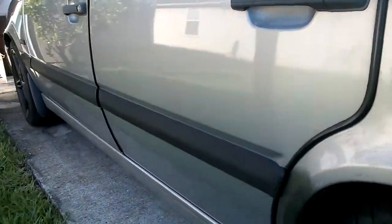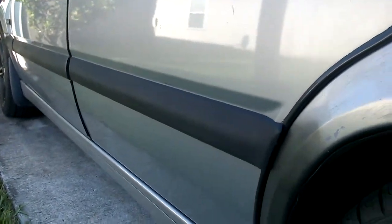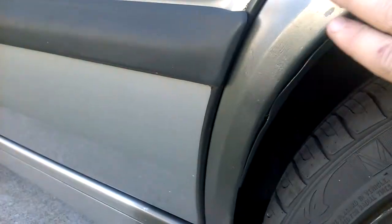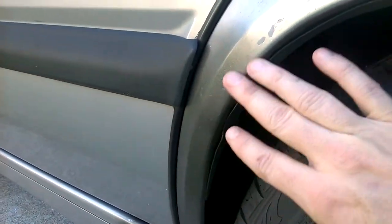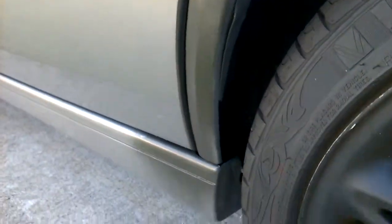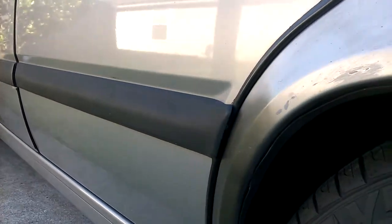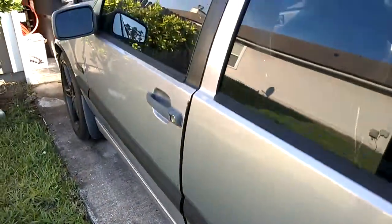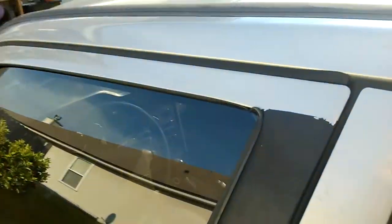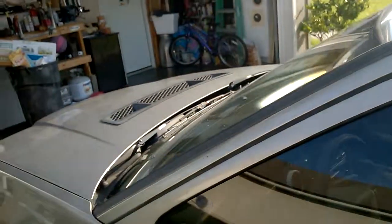The driver's side has a reasonable sheen — it could use a polish. On the leading edge I sprayed automotive enamel primer to prevent surface oxidation after peeling the trim off. The pillars have plastic dip on them; I peeled it off on some and left it on others.